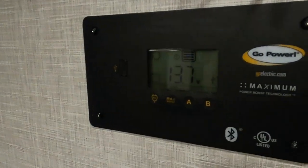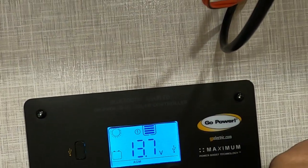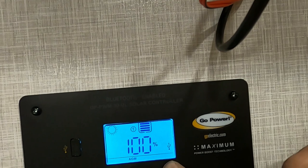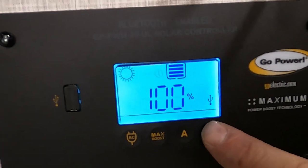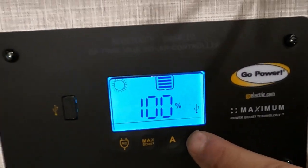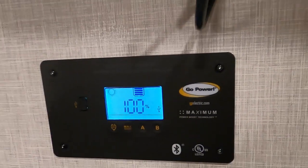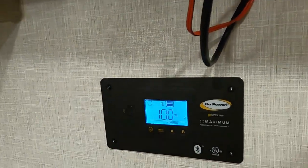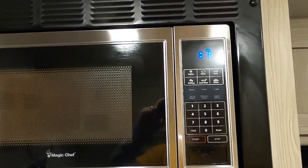Down here's your Go Power controller. The only concern with this is to make sure, so I can show you how to do it. You hold in A here. There's a B. And that will move. You want to make sure you're on your flooded. Go all the way back around on this. One thing you need to be concerned with is make sure you're on flooded battery, which is the kind of battery that you have on these. The main purpose of this is to keep your solar panel from overcharging your batteries. You're at 100%. That's the sole purpose in that. Video will explain more. Continuing here in the living room, we've got a self-explanatory microwave,